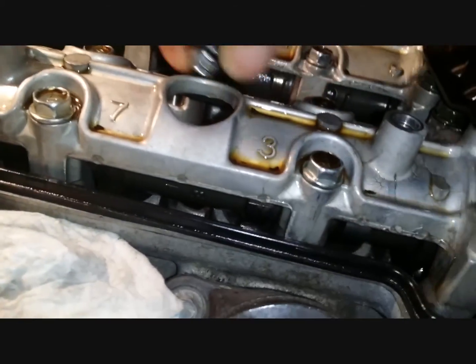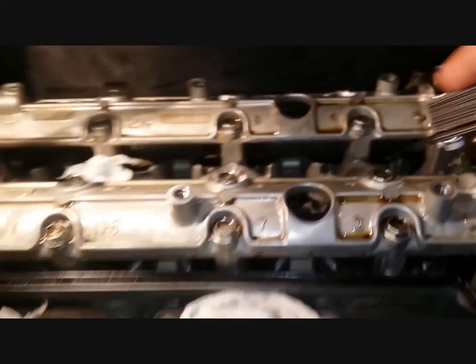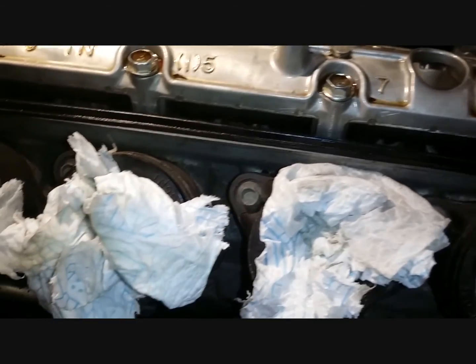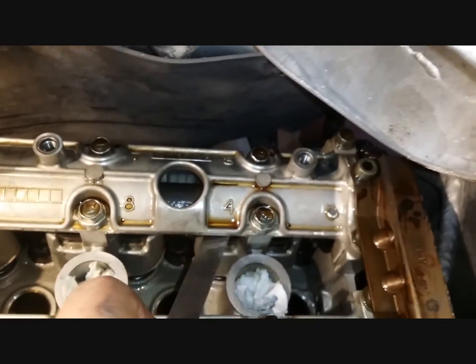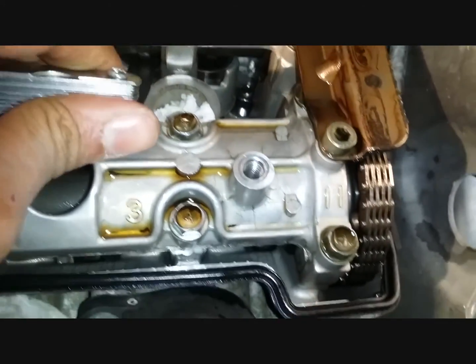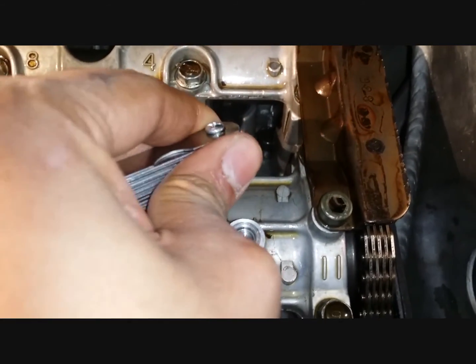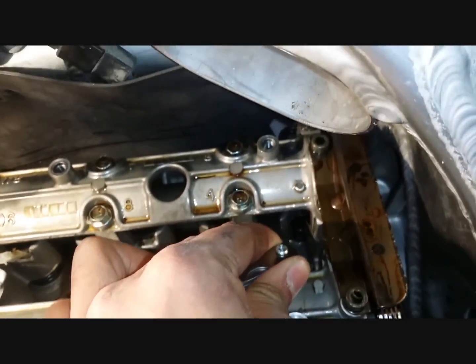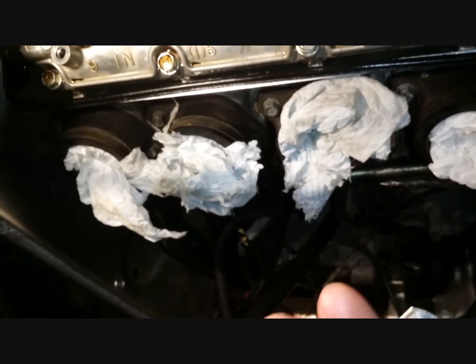Yep. Let's try on the second one. Okay, that's looking good. It's beautifully slipping in. So now I'll try a 0.23, or maybe I'll try 0.25. Let's see how that goes. That's a tight fit there. It won't go in. Let's try the other one. Yeah, well, it just slips in. So again, it looks like it's within range. I don't even have to try 0.3 because it's already a very tight interference fit.